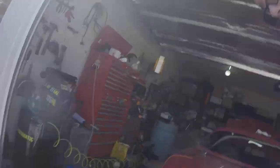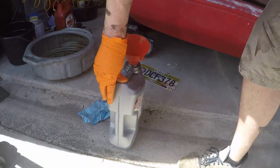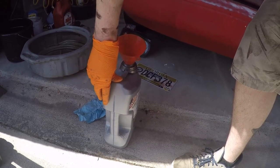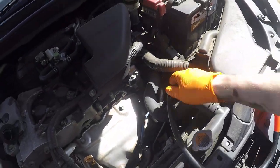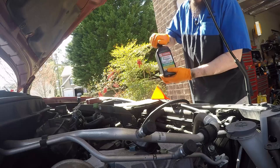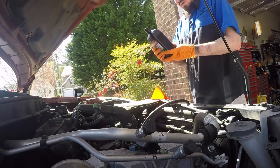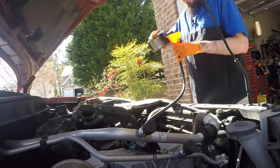We took the drain pan and carefully poured it into a used oil bottle — funnels are your friend. Got about four and a half quarts, so roughly five quarts total. We'll throw four and a half back in, check the level, warm it up. The dipstick tube for the transmission is right here — I've got a piece of hose and a funnel hooked up so we don't spill anything. This is Castrol Transmax CVT — it meets NS2 qualifications. The wife's Lancer takes the same stuff so I've had no issues with it, and it should do Blake some good.